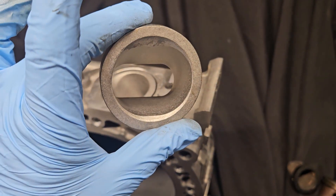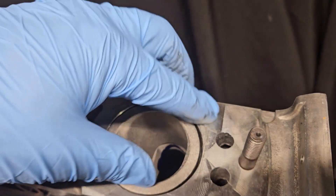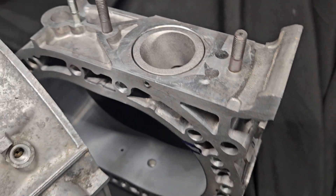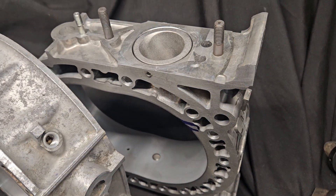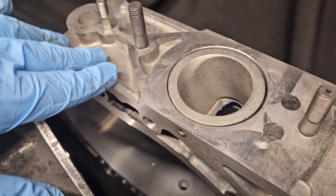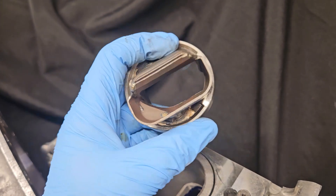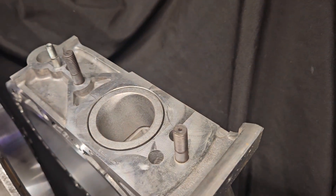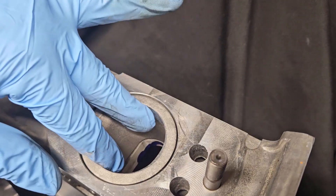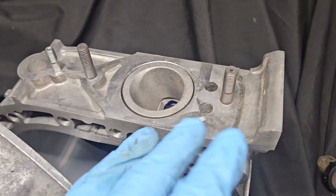Since I have some aftermarket sleeves in right now, I figured I'd talk about it. They're fantastic — straight-through design, they basically drop right in. In some cases you need to trim down the EGR if there's any type of EGR tube sticking up in there, then you roll-pin them back in. If you want to see how to remove those roll pins, I'll drop the link below from previous videos. You can see — even with a brand new 20B housing — we pop that OE sleeve out.